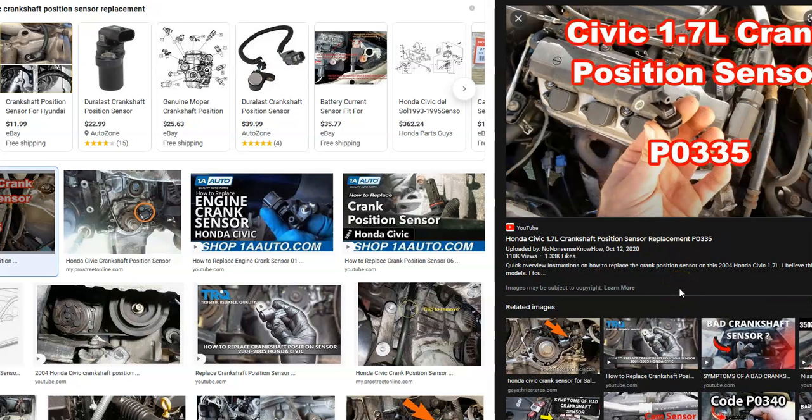So what do you do if you have a Honda with the P0339 code? Well, the first thing to do is Google where the crankshaft position sensor is located on your engine and go check it out. Check out the harness and be sure to check the wiring going back to the ECM. Be sure it's plugged in good. Also check if there's a blown fuse, because quite commonly the crankshaft position sensor and the camshaft position sensor are on a shared circuit controlled by a fuse. If there's a problem in the wiring or somewhere else, that fuse could have blown. So even if you check all the wiring and replace the sensor, you could still have issues if the fuse is blown.